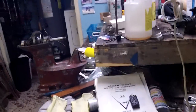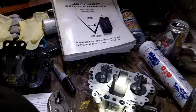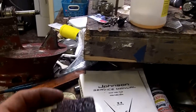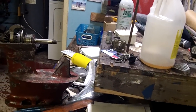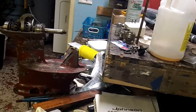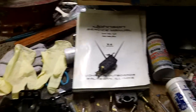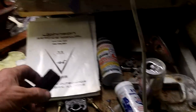The carb didn't inspire confidence, really — pretty dirty on the inside. I don't know if the needles are seating well. I don't know if there's anything to do about it. Does cork float? It floats, but it's cork — I figured it would, even if it's bad. Looks like there's something on it, shellac or something. I'd like to replace it with something a little more modern. The carb rebuild kit was on back order and kind of pricey, so I didn't get it, but I did buy a seat and was going to clean it up a little and replace the seat and put it back on. I'm not sure about this now though.